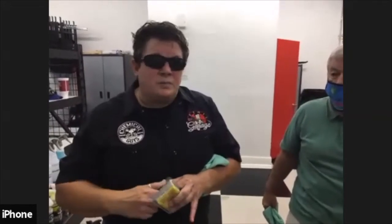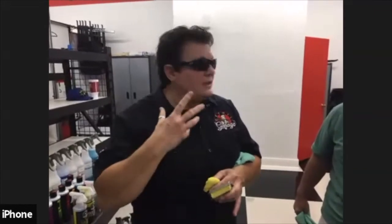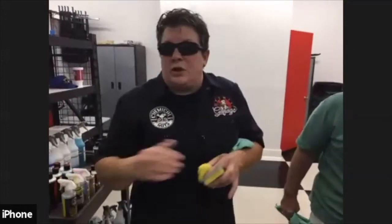If you have a cheaper brand, I don't recommend doing a clay bar on it because you might mar the surface. When you're doing a clay bar on a clear bra or a wrapped surface, you're probably going to use a light clay bar and be very, very gentle with it, because again, we don't want to mar the surface. So it is possible to treat wraps and vinyl stripes, but you just have to have a mindset. Because if anyone has a wrap, once you mar the wrap, it's tough, it's done, it's toast.